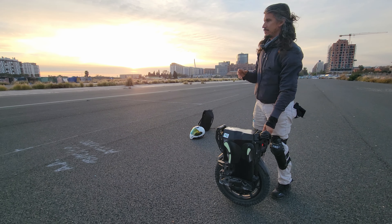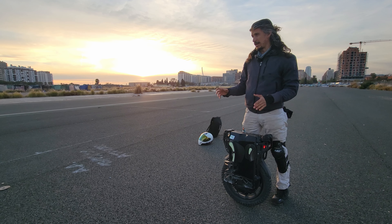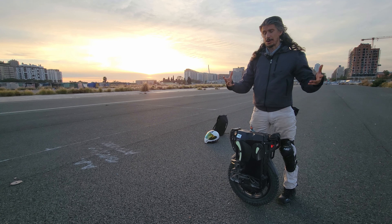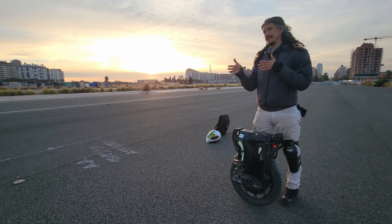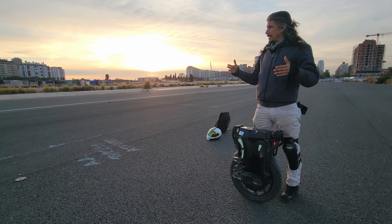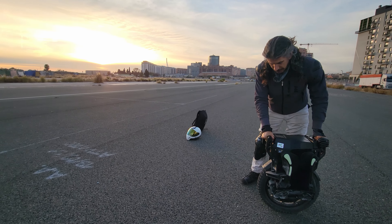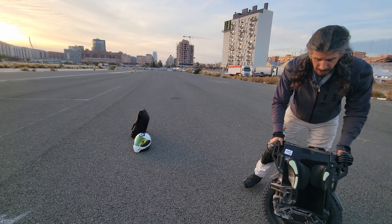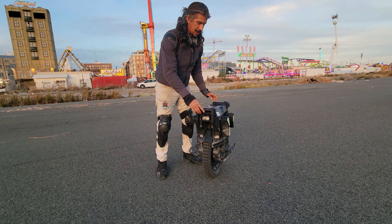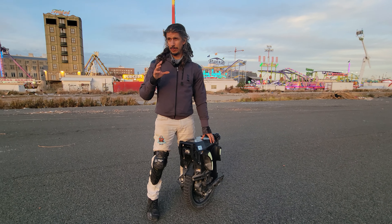There's a high speed mode and a low battery reserve mode too. I haven't played around with those too much. The high speed mode gives you more speed but less torque, so most people don't really need it unless you're on a straight. One of our other complaints with this wheel is that it's a really gusty wheel — it's like a sail. It's a big tall wheel, your pedals are high up, it puts your body high, so when you're riding fast the wind can really affect you. So we let out some PSI and adjusted our suspension. The suspension feels much, much better — even for jumps. We're going to do some high speed tests to see if the lower tire pressure gives us more stability.